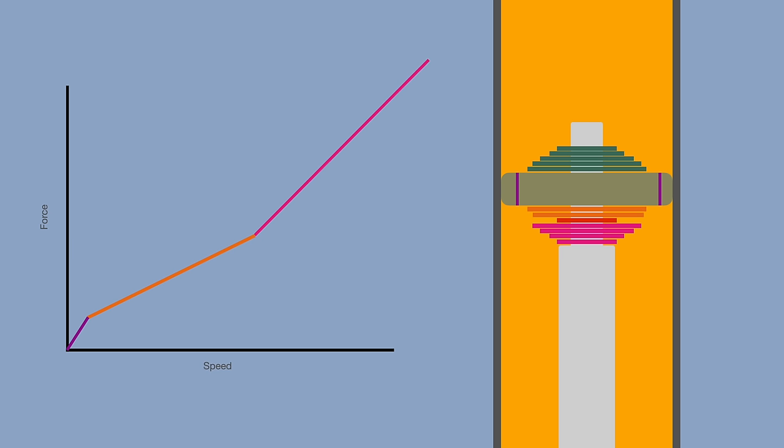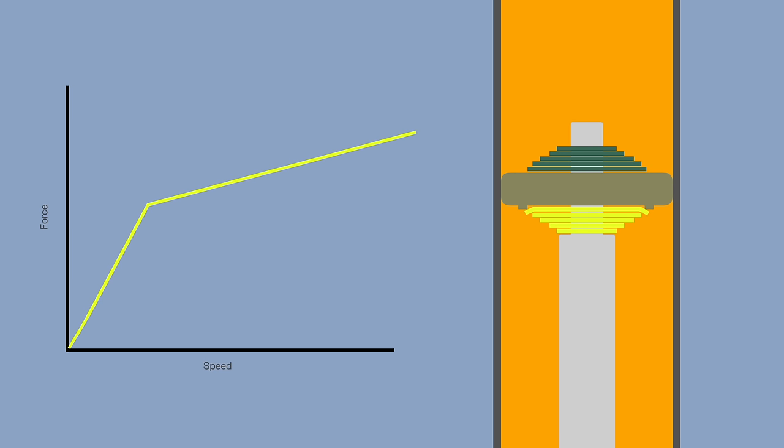A thicker shim will move this point farther up the graph. You can bend this graph the other way by preloading the first shim. Icon and Bilstein do this on a lot of their off-road shocks. This will give you a more firm ride at low speeds. Washboard roads will be more harsh, but it won't flop around like an old Cadillac in low-speed corners.